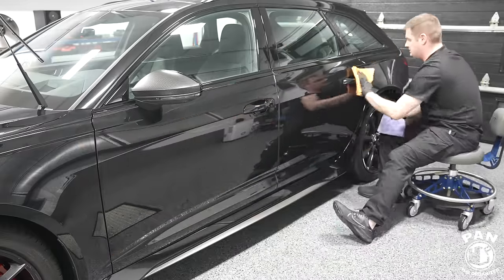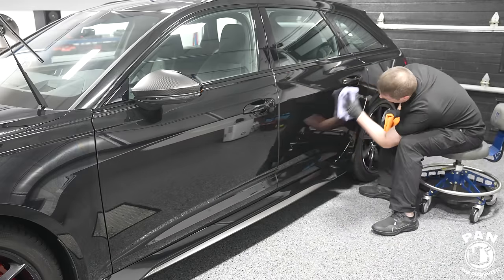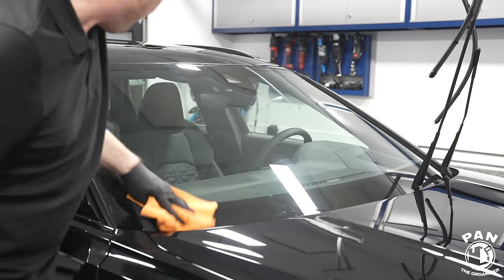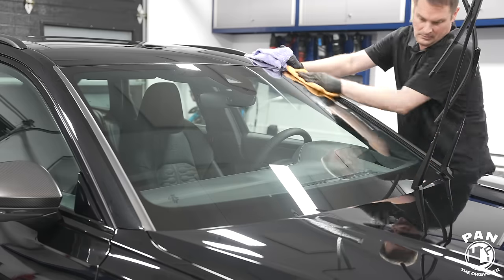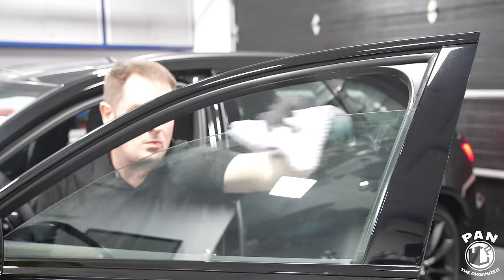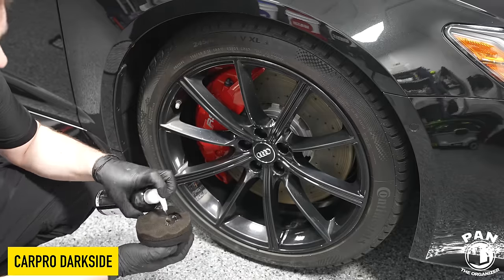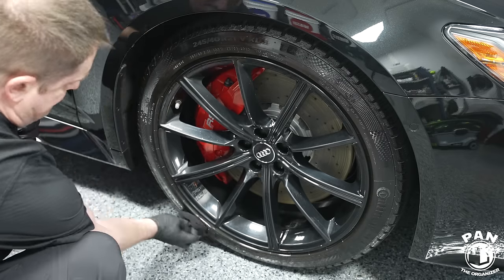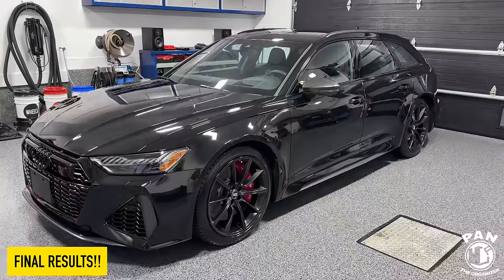With enough experience, I'm able to coat two to three panels at once — start the first panel, coat it, set a five-minute timer, move on to the second and third panel, and by the time those are coated the timer has gone by for the first. I did the same for the glass: applied in circular motion, let it sit five minutes, leveled with the Pearl towel, and did the final buff with the Eagle Edgeless towel. I used the finishing glass cleaner from Gyeon. For the tires, as a final touch, I used CarPro Dark Side — a tire sealant that lasts roughly three to six weeks in my conditions.